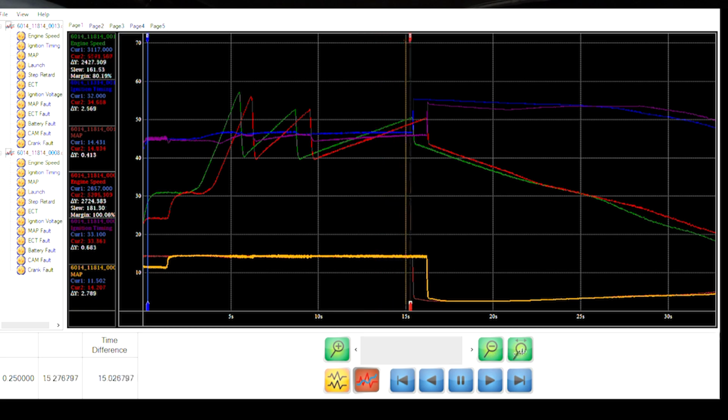What I need to do next time is actually go on the LS1 high output setting, data log it, and then go back to my custom timing table that I made. I went through and adjusted one to try and help the car get off the line, and it helped a little bit, but I kept it pretty mild because I'm not a master tuner. I actually don't know a lot, so I kept the timing relatively mild, and I think I gained at the lower end but lost at the upper end, so that needs some more fine tuning. But I was actually racing at that point, so it was kind of difficult to go in there and do that. So anyways, this is what this looks like, and let me show you the Sniper software.